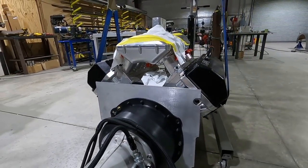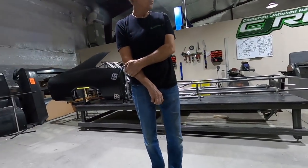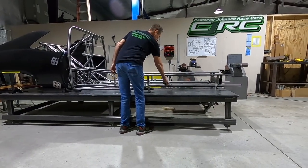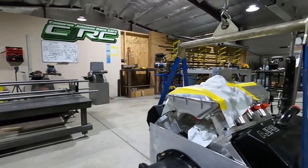You can see on the bottom notch and top notch it fits the dual frame rail. This will still be cut once the halo and chassis are done — he'll mark and cut after. With the dual frame rail height, you can go a little taller, but too tall and you have issues getting into the headers and heads. Too low and you have issues with the fuel pump mounting off the side of the blower. For blower cars, we run about six and three-eighths inches inside from the top of the bottom frame rail.